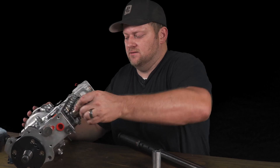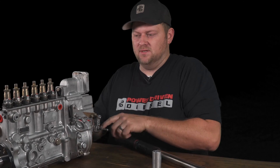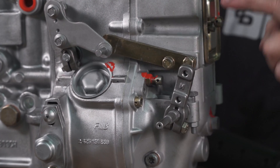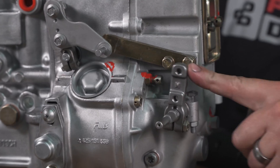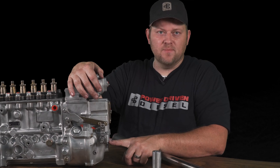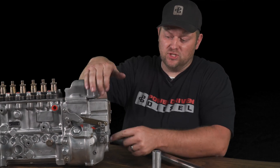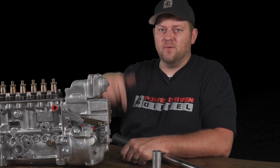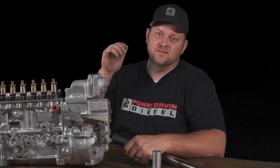Put your lines back on, put your air horn back on, and fire your truck up. Generally when you go bigger on the delivery valve the idle will drop a tiny bit. If you don't know how to set your idle, it's right back here on the pump. There's a 10-millimeter screw — it throttles up to raise the idle, down goes down. There's a little jam nut on the bottom. You've got to reach in there with a 10-millimeter open-end wrench to loosen the bottom nut, then reach in on the top and raise or drop your idle. Repeat on all six — slam dunk, easy 100 horsepower. Thanks, guys.